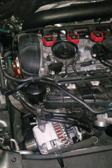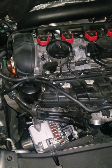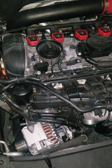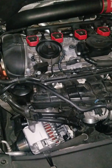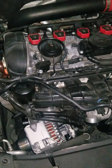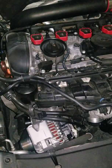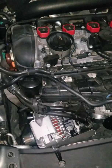That clutch should only activate at high revs. If you're getting an alternator light and it goes out at low revs, and sometimes revving up makes it come back on — that's what happened to me. The light came on, but by driving around the clutch activated again, so when I had it tested it showed fine. Finally it went off again at home, and I checked my voltmeter instantly — dead, 12.3. Hit the gas once, tries to come back, goes back off. Hit the gas a few times, clutch finally catches, and it's on at 100%. That means the diodes are good — it's just that clutch slipping.